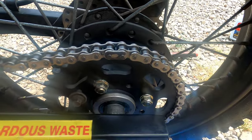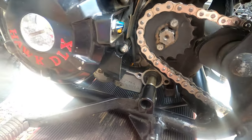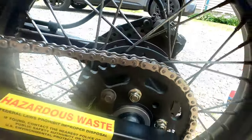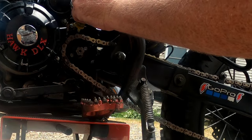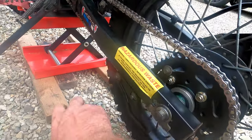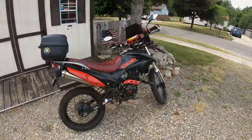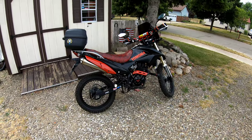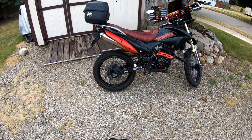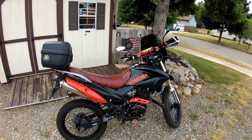Now we just need to make sure everything is lined up well. I'm going to grease it up — the chain is loose obviously, but I want to make sure everything is spinning okay before tightening things up. Looks like nothing is rubbing. I feel like I got everything on there straight, kept a decent amount of slack on the chain — this will loosen up over the next couple of weeks. I did a couple of loops around the block and I already like this 17/45 gear ratio.